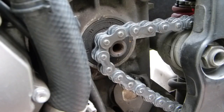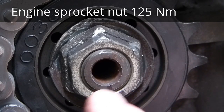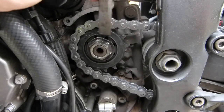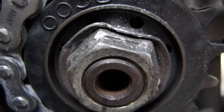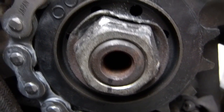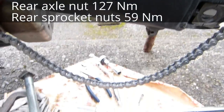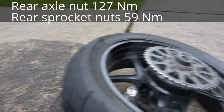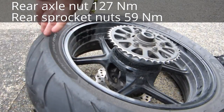Now I can remove and replace the engine sprocket. The old sprocket has been removed; the new one goes on with a little fiddling. Tighten it — you can see the movement marker lines almost line up. Don't forget to bend the tab back; that's enough to hold it from rotating. The permanent marker lines confirm alignment. Done at the front end and done with riveting. Now the rear wheel can be removed. Use wax paper so the chain doesn't pick up stone grit. When removing the wheel, make sure it's resting on rubber, not on the brake.